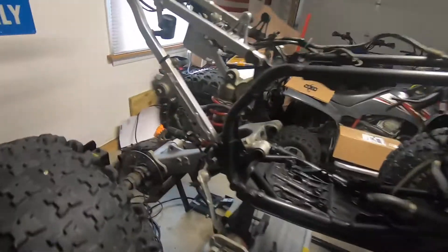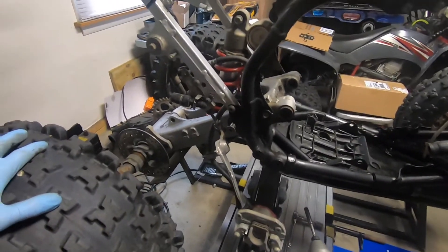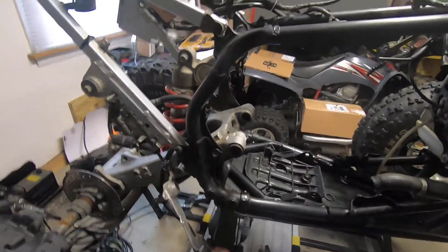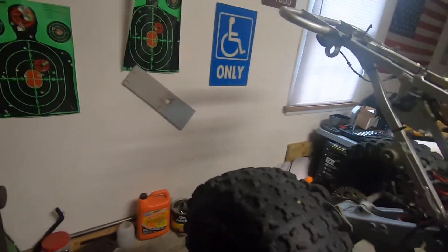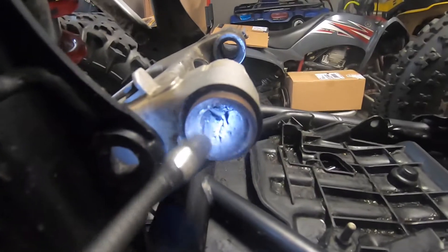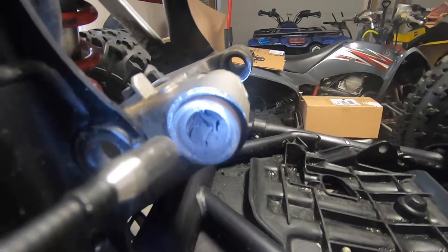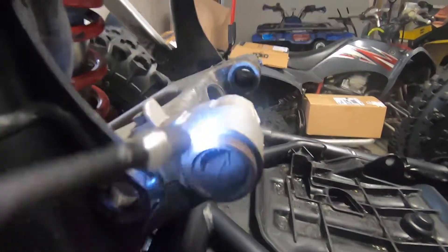It's hard to explain, but it clearly takes a special socket. So I'm going to change gears a little bit — rather than taking the axle off the rack, I'm just going to work on it on here. I'll try to get the bearings out while it's on here. If you guys can take a look in there, those needle bearings are toast and they need to be replaced. This side here doesn't look too bad — it's rusty but not as bad.